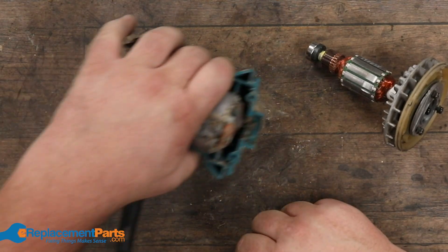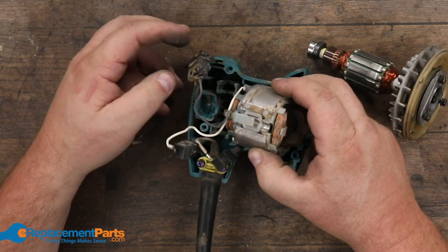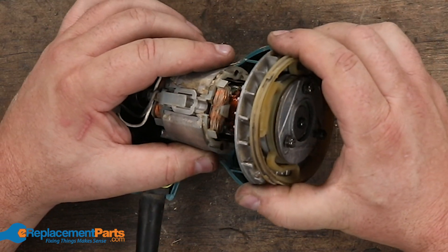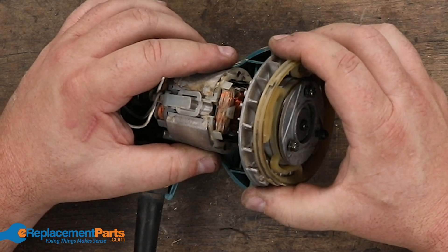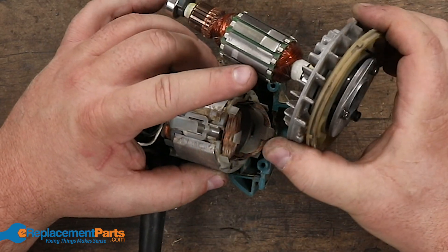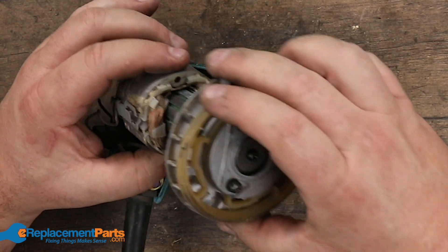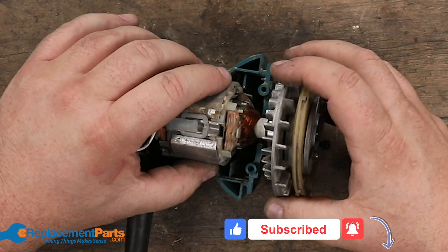As far as reassembly of the sander, there's not much to it. This is probably one of your most simpler tools to deal with — it just drops inside. You'll notice it is loose, and it's supposed to be loose. You don't want this rubbing against the inside; you want it close so it creates a stronger magnetic field. But if it starts rubbing, next thing you know you're going to start wearing down the inside or getting shorts — shortening out your wires and so on. So there is normally a fair bit of play; I'm talking I could probably put a wooden matchstick almost between the two. So I'm going to drop this down.